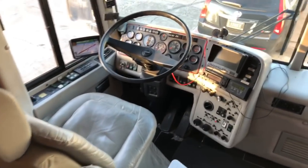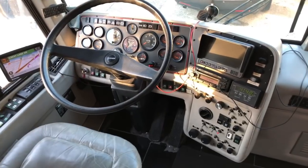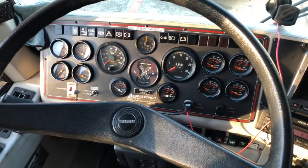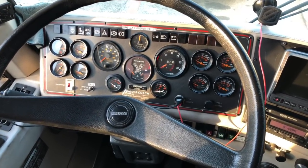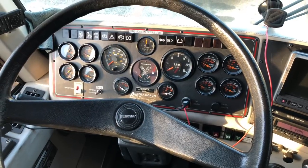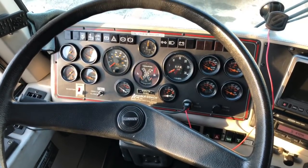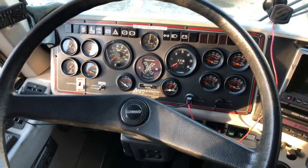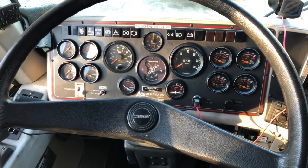Here's the part where I drive. This is a basic control panel — you have all your controls and your gauges that show you your air, your battery, your fuel. You have what's called a twin pyro gauge that tells you the temperature of your exhaust. You don't want your exhaust to get too hot — your turbo, when you're going up a mountain, you can overheat. You also have your transmission temperature, oil temperature, water temperature — a lot of gauges.